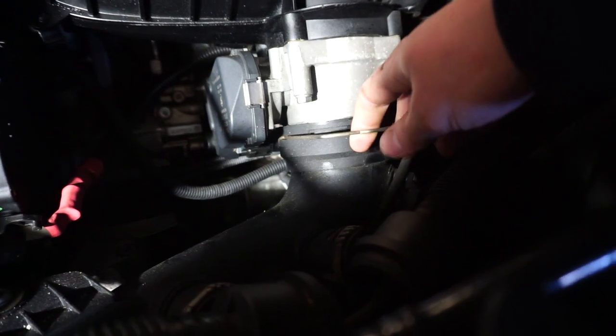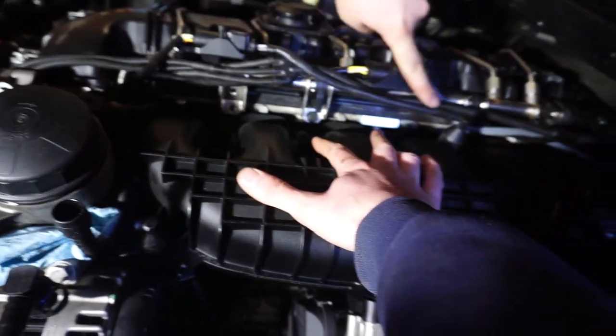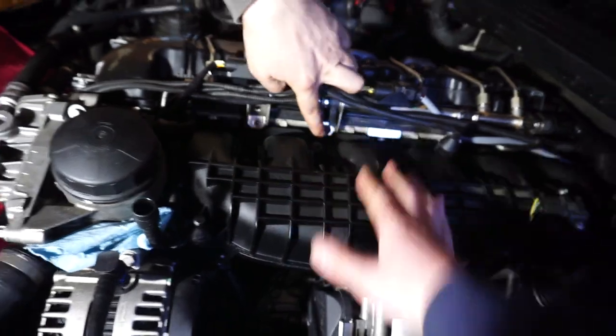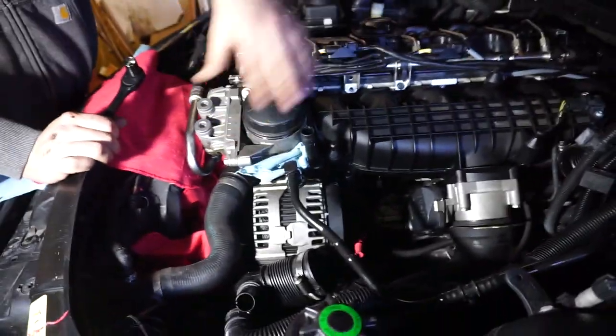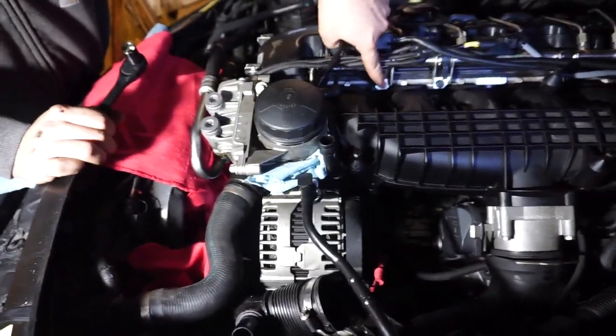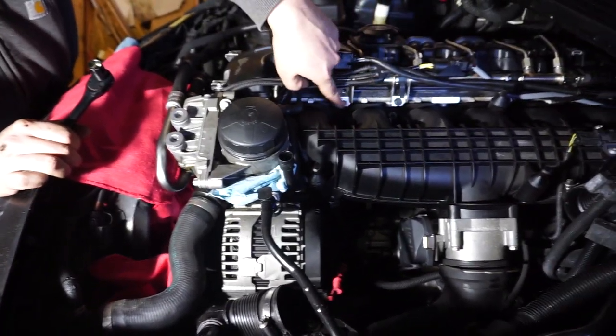And then also we're gonna take this duct loose here. Yep, you just gotta put a screwdriver under this ring right here, slide it up, and then we're gonna work on taking out the manifold. These intake manifold bolts, which I believe are an 11, if I remember correctly. Yeah, I think an 11. That'll give us access to this, and then we're changing the gaskets on here. Right, and we'll get to look at the valves, too, and see how much gunk is on them.